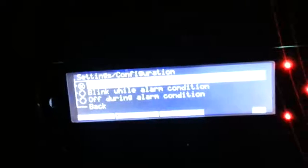So now the outputs. The output has its own LED settings output. For the red LED, I told it to read the RGB LED controller that outputs the red LED signal. So I pretty much just matched up the controllers to the individual diodes on the LED. So red goes to red, green goes to green, blue goes to blue. You get the idea. So yeah, that's pretty much it. Normal operation. You can set it up for a whole bunch of stuff. You can make it blink. That's pretty cool. I just noticed that. So anyway, that's how I got it to do what I wanted to do. So now either the water temperature or the CPU temperature, whichever one is hotter, the LED will display the status of that. So that is pretty freaking cool, and I can imagine you can do this with a whole bunch of stuff.